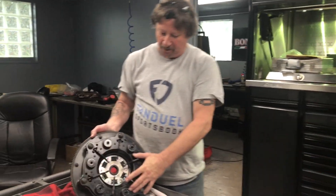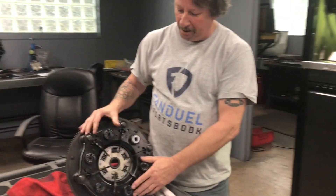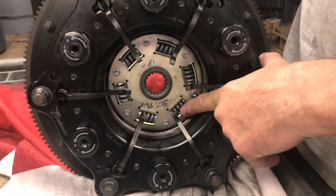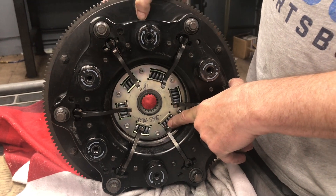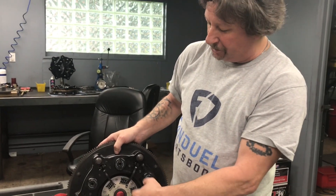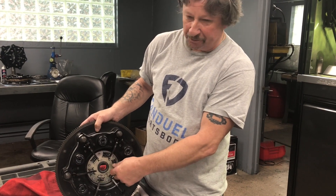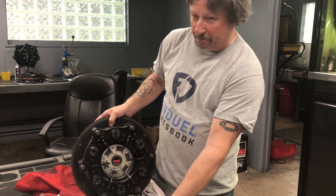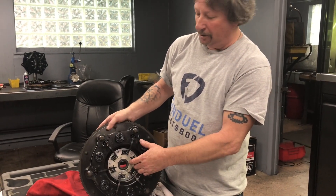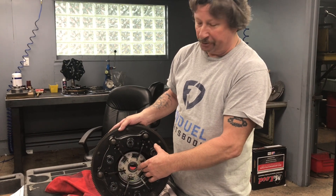Basically this is our 10-inch small, low profile clutch so we can fit in a standard bell housing. If you can see in here, this is a sprung hub. What it does is it actually helps with the shock to the input shaft. I believe we're the only company that offers a sprung hub with sintered iron. It's multi-adjustable — dual spring, single springs, triple, six levers, three levers — whatever it needs to be to get your application down the road. We can adapt to it with multi different disc compounds, so we have a pretty large product line for whatever you're running.